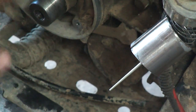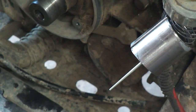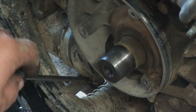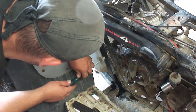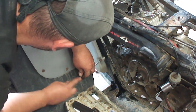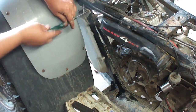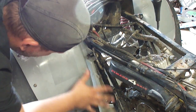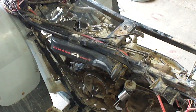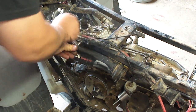There's the air duct system for the belt drive — there's a boot right here, and while I'm right here looking at it I'm gonna take this off. There are a couple of Torx bits here — these are T25s. I'll take these screws out and loosen that up, which will give us some room to get the engine out. Then take this air duct off — these are 3/8 screws.